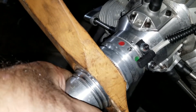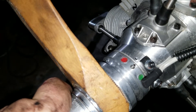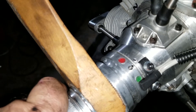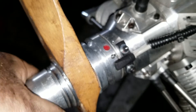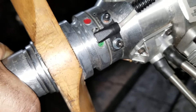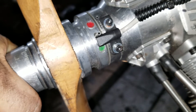On this engine I checked it and it's seven degrees before top dead center on low RPMs — all three sparks are firing. It fires right there, so that's seven to five degrees somewhere in that vicinity. I know this particular one is seven degrees because I tested it. Once it does that, it gets into running mode and then it fires when the magnet enters the sensor. It does that until 4,000 RPMs. After 4,000 RPMs there's no more curve, and it's what you see is what you get — wherever you have the sensor set, that's what it's going to be: 30 degrees before top dead center.